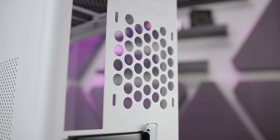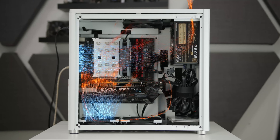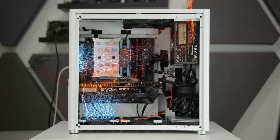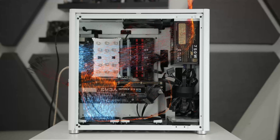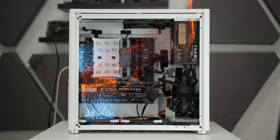Unfortunately I didn't have time to test another setup I think could be good — the one I mentioned earlier: rear intake with the filter, flip the CPU cooler's fan exhausting forward, top-front exhaust working with the PSU, and one or two base intakes. I limit case testing fans to three to be reasonable. I think this setup idea is good, but I'm not a fan of turning an unfiltered exhaust into a filtered intake — it just cuts down free area, resulting in more noise and less airflow.